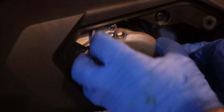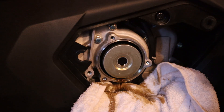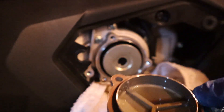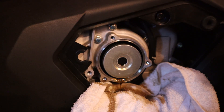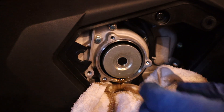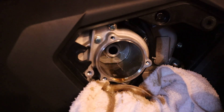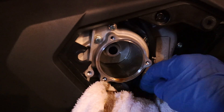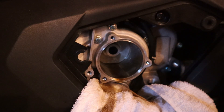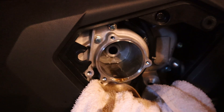The cap's going to come off and it's going to be a little messy. There's the cap. I'm going to change the O-ring too. They say if it's nice and round you don't have to, and this one feels good, but I'll change it anyway since I have it. This should pop right out. I'll put the old filter in the baggie so it doesn't make a big mess. I'll let that drip a bit into the pan underneath.